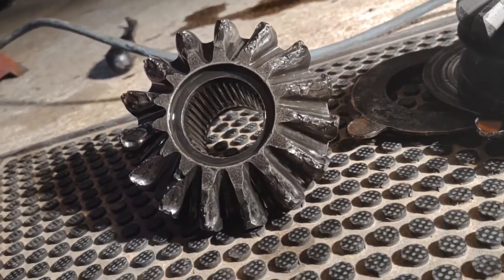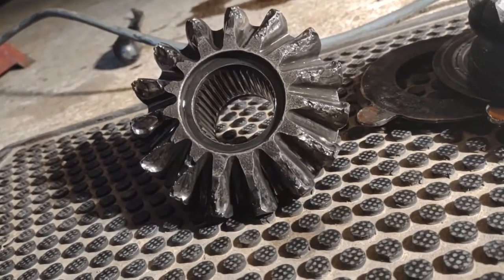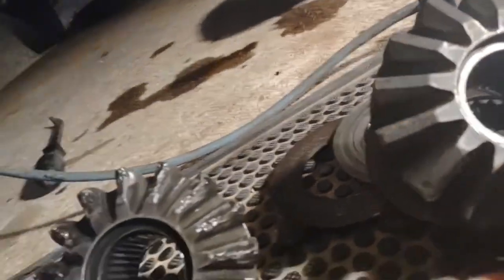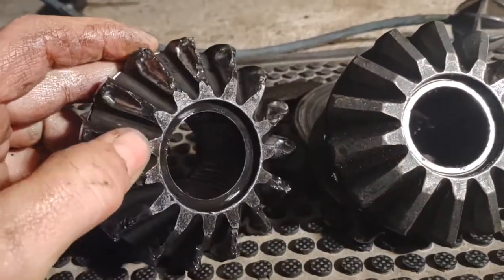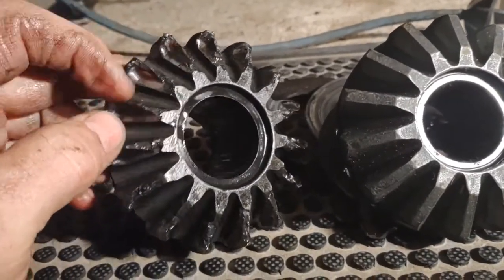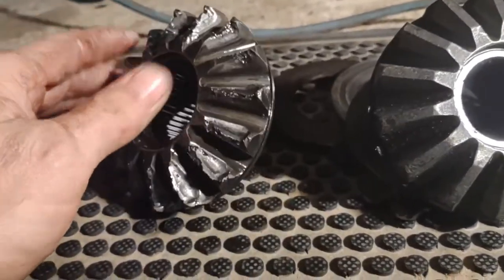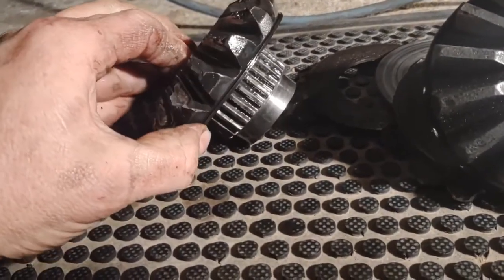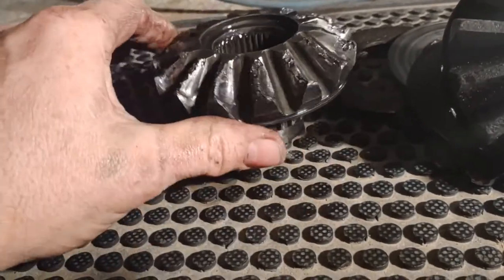So my truck's down until I buy a set of gears. I can use the clutches — the shaft diameter is different. That spline is smaller; I can look at it and tell the inner shaft diameter and outer shaft diameter are different. I can put it back up there but I ain't hauling any loads because that gear is had it — done gone.